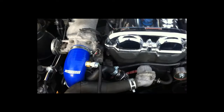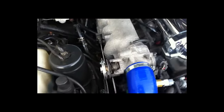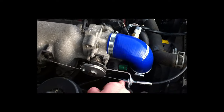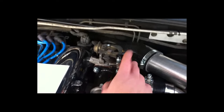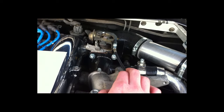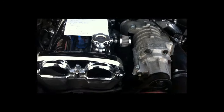This runs a dual throttle body setup. This is your main throttle body with the main cable coming in from the accelerator pedal. I've got an adapter plate and mount here to allow a second cable to be set up, which is run along the radiator and over to the inlet on the supercharger. This is the second throttle body - what this allows for is smoother idling, less droop, and it's also good for controlling the noise. Note that you have to have this cracked open just a little bit using the adjusting screw to make sure some of these pipes don't collapse.